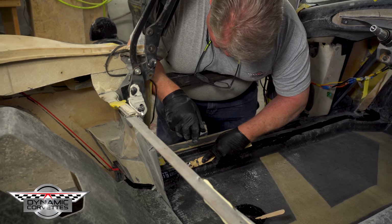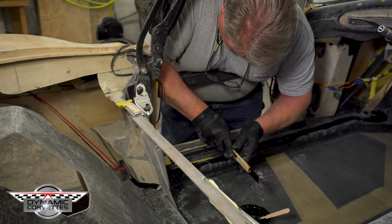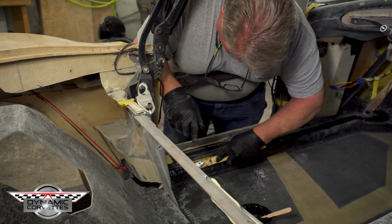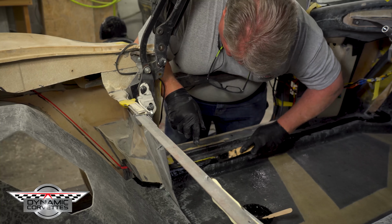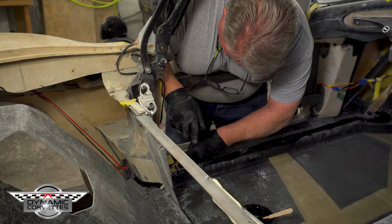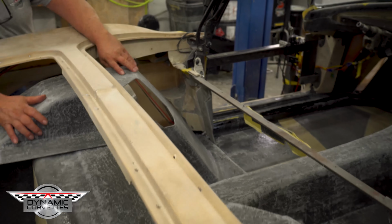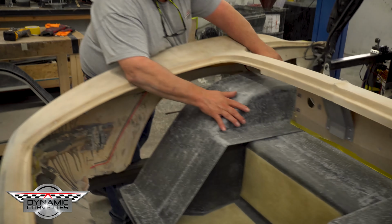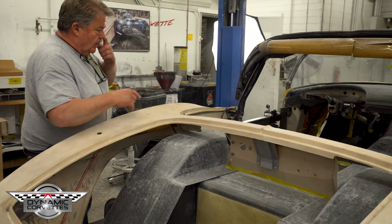Monocoque design. It's where the body and the floors all fasten together, preferably with epoxy glued together. We have a lot of panels in this design that overlap to give us that monocoque design, the strength. Makes everything kind of fit like a glove. So, one thing to keep in mind, don't forget to have your main tubs sitting on the back of the floor when you're gluing the main floor in.